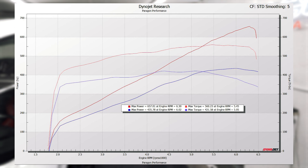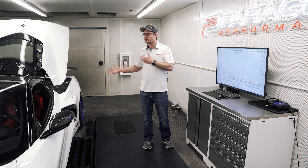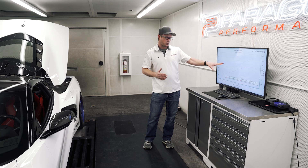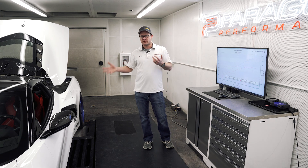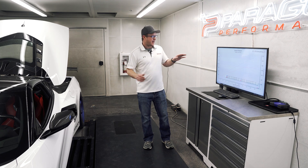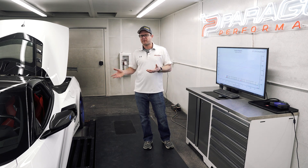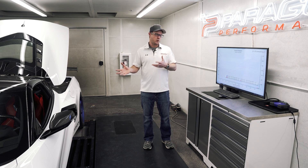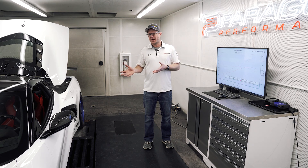That's an incredible jump from stock — I have a stock baseline up here that is very typical at 435 at the wheels and 421 torque. One thing I really like about the ProCharger setup is that being a centrifugal style supercharger it builds boost linearly with RPM. When you put your foot down from low RPMs you do have some boost and extra torque, but it doesn't make the higher boost until higher RPMs. That gives you the benefit of not having to worry about fighting for traction under low-traction conditions. The car can hook up and just keep building more torque and power with RPM, so this thing feels like its existing power band just extended further. And if you're taking this car on a road course, it's going to be a lot easier to manage that power coming out of corners.